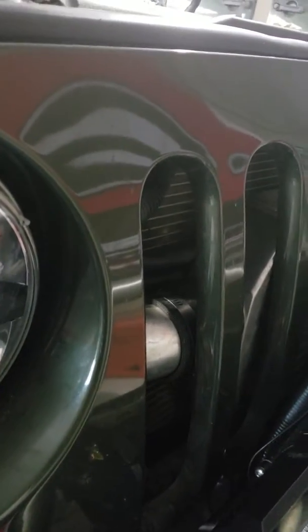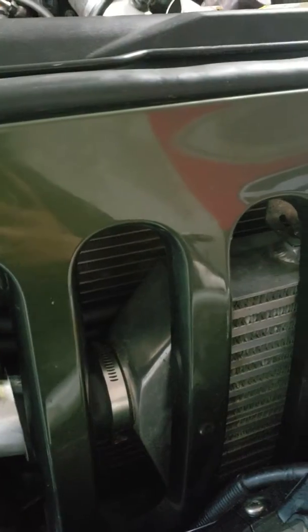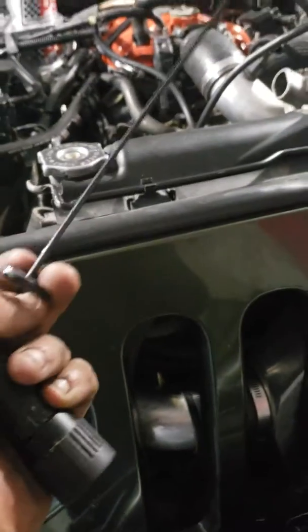A lot of times the way that the condenser and the radiator sit in there, they've actually got a rake to them. I don't know if you can see it or not, but it causes the gap between the intercooler and the AC condenser to get pretty small at the bottom, so you have to mount it up top. But you can see the caps for the little push throughs. And those are the mounts.